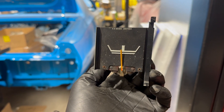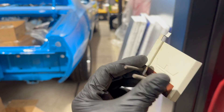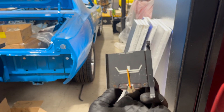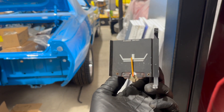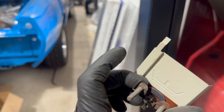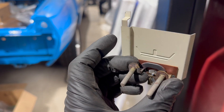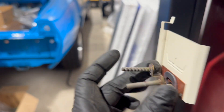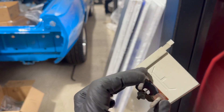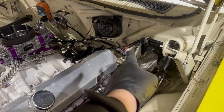People on the internet and various groups love to complain about the ammeter. They love to say that these things cause dash fires and they're going to burn your classic to the ground. Yes, that is at least possible — I've only ever seen one that was at all crispy, and incidentally it was in this very car. Usually they're fine. The real issue, in my view, is the problem I see again and again in that firewall connector. But do understand, because this amp gauge is in the circuit, there are two more connections on the back of it — two more possibilities for poor contact, for heating up, and loss of power.